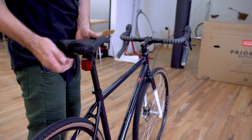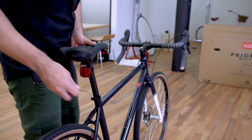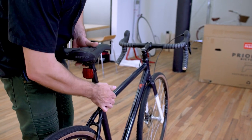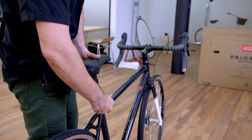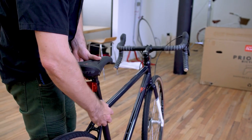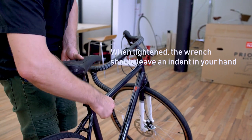As a good starting position for your saddle, you want it to be relatively the same height from the ground as your hip. Loosen the seat post clamp, put the saddle at just about the right height as close as you can get for now, make sure the saddle is straight, and then tighten it back down.